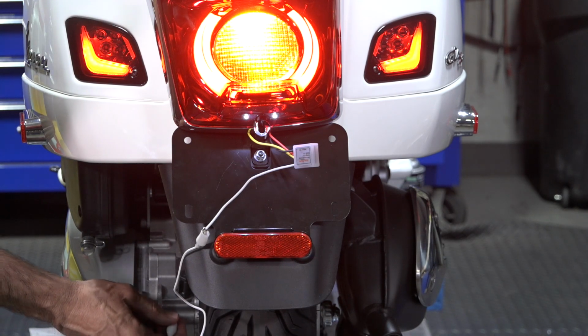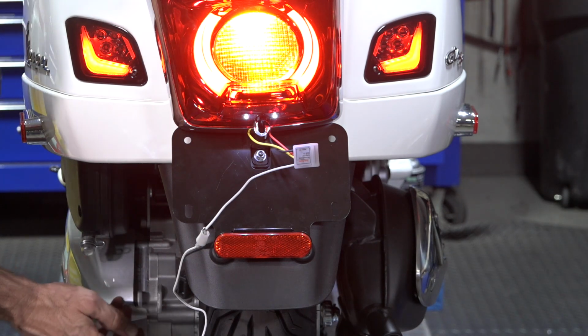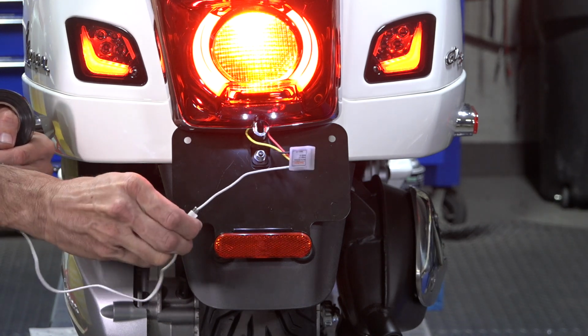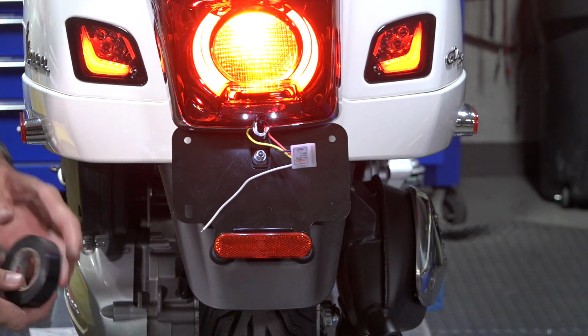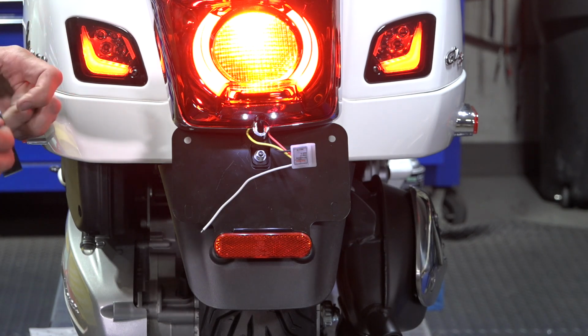Or there's the slowest, and then we'll go very slow. That's way too fast. Just pick something that's good. Like, I kind of like that right there. That's where it gets somebody's attention. And just go ahead and get rid of the wire, and it's all programmed. So next time you turn the ignition off, it remembers that setting.